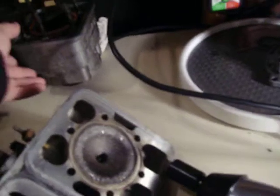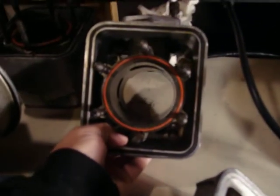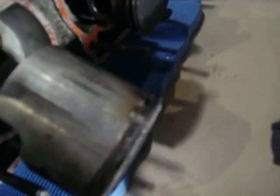The actual cylinders themselves look fairly clean, so they appear salvageable — there are two of those. This is the worst piston here. You can see that it's actually been scored and the rings have been fused right to the side of the piston. So the pistons need replacing.